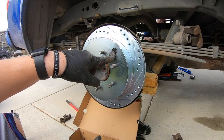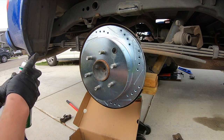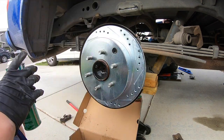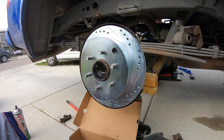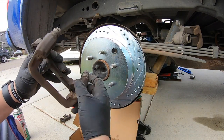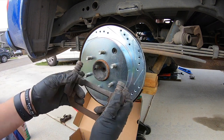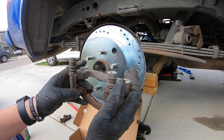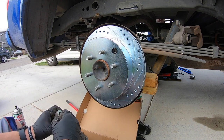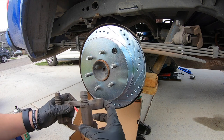I needed to reorient that piece back into place — just pull it off and redo it if that happens. Hit it with some more brake clean. I can never use enough brake clean. Then clean up the hub surface as well; if you have a metal scraper pad you can get it really nice and clean, but at minimum spray brake clean on it.